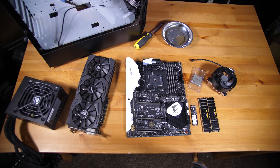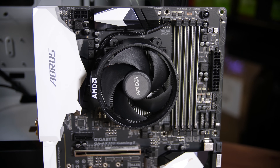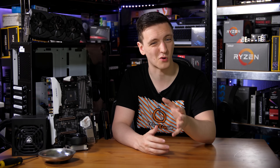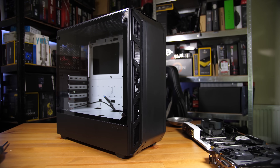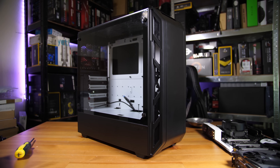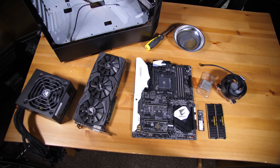In terms of the cooler, we're using the stock cooler that comes with the 2600, mostly because of pricing. If you want to splash out, a Cooler Master Hyper 212 EVO for around 20-30 pounds allows you to overclock a good amount, whereas with the stock cooler we probably won't be able to. We also have a budget but good quality Cougar 450 watt power supply, the Phanteks Eclipse P350X tempered glass case, and a Gigabyte X370 Gaming 5 motherboard which is great value due to recent price drops.